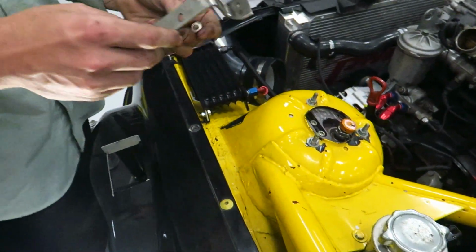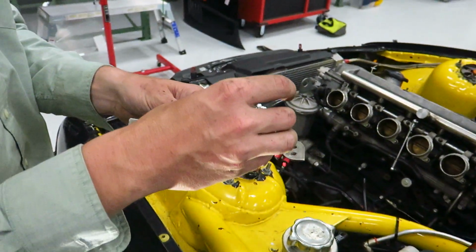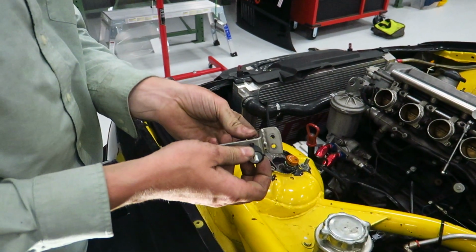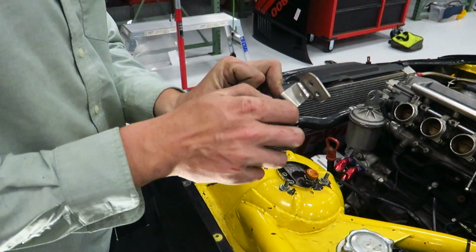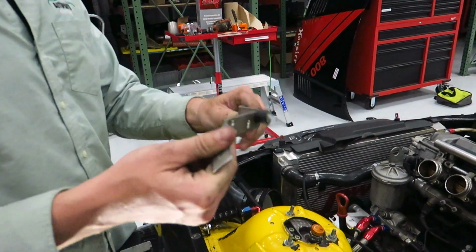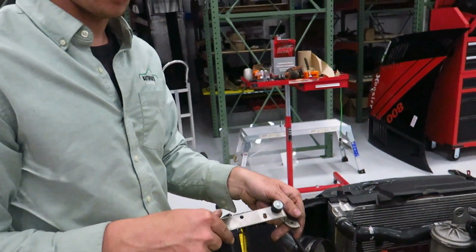So instead of fastening it directly to the pump, I was just getting these guys ready, little isolators, so they'll screw into the pump, and then hopefully everything will fit together. Now the pump's got a little bit of play in there, and I already had some washers spacing it up a little bit, so hopefully with these little isolators everything will stay tight more easily. I might put a little Loctite on there, and we'll give that a go.